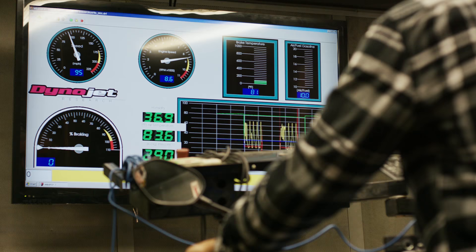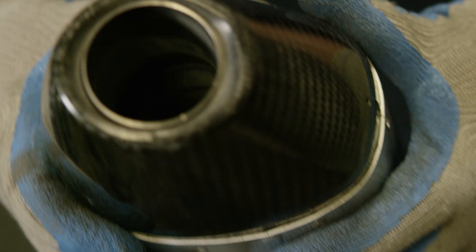It's important to use the appropriate amount of packing material. In racing, we've found that as little as 50 to 100 grams of packing difference can be measured as a power difference on the dyno. So if you want peak power, use exactly the amount of packing that Yoshimura has suggested for your muffler.